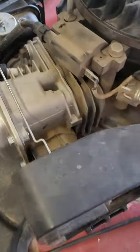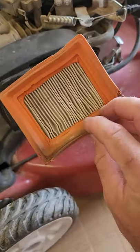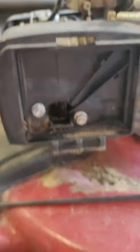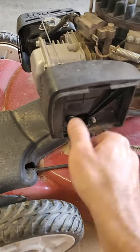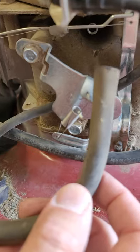So the next step — and I'm sure what we're going to find in here is not good, because when you look at the intake to that carb, it's dirty. Judging from the condition of our air filter here, I am not surprised. I think what we're going to find is a whole bunch of junk in the carb. Some of it may not even be visible. We'll pull this housing off, pull the carb off, take the bowl off, and have a look at the contents in there and give it a good cleaning.